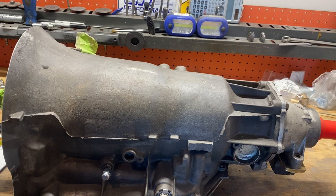I found it very odd when I was reading the directions. You can actually see this little divot where we drilled through with a one-eighth drill bit to see where it was poking through underneath — and I was like, wow, that's crazy. That 100% explains why you see so many aftermarket bell housings bolted on with that huge gap between the case and the bell. It wasn't because the people didn't care — it's because they followed the directions.